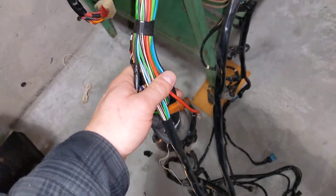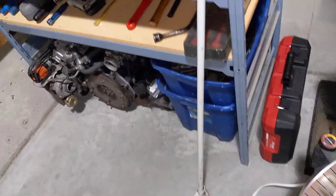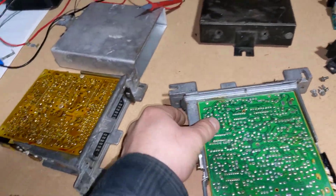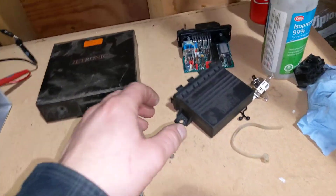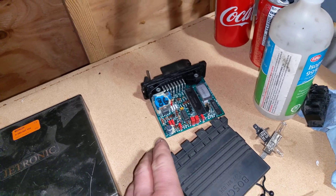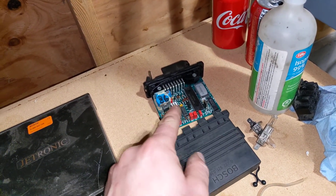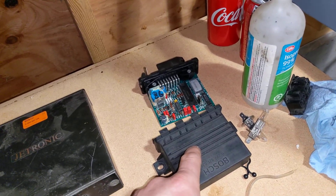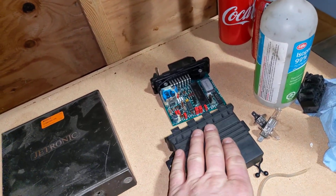As you can see there's quite a lot more wiring involved in the Milano 3.0 system, as it has the fuel injection computer seen here — same as the original one — as well as an electronic digital ignition system for controlling the ignition advance and retard. That digital electronic ignition is obviously one of the major reasons to be doing this work.